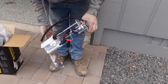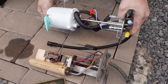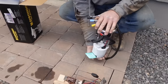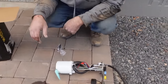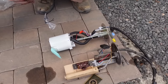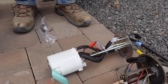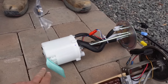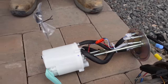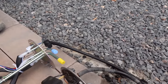The new pump has a slightly different design - same but different. This one's adjustable-ish. There's a little pigtail in there, so we've got a new connector. Here's our new pump - you can see there's a little bit of difference because this is an aftermarket pump. You've got your little sock, you've got your pump, and again your little paddle for the fuel level sender. The one thing I notice is they did come with a different connector than the stock connector, but they give you a little pigtail to put on the other side.